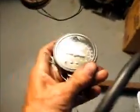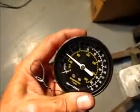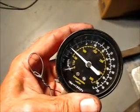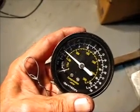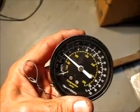Standard head, and we'll just put the drill on here for a few moments, and just see what we got. So let's just have a look at that. So it says here that I have got, and I can't read it through my thing here, looks like about 60-70 pounds of pressure, which is normally about right for a standard head. It's about 60 or 70 pounds psi of pressure. Now we'll put the other head on and give that a try.